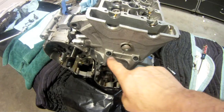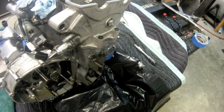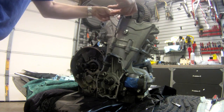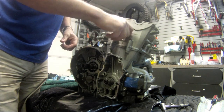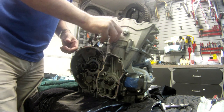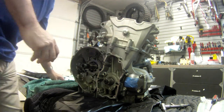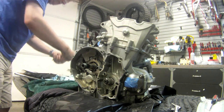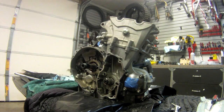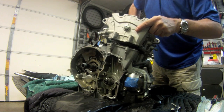There are two more bolts that need to come off before the cylinder head can actually slide off. It's pretty loose right now, but I've just got to undo these two first. This was the bolt here that has to be removed to allow the cam chain to go in — don't need to worry about that right now, it can stay in place. Both bolts are the same length, and hopefully now the cylinder head will just lift off nice and easily — there she goes.